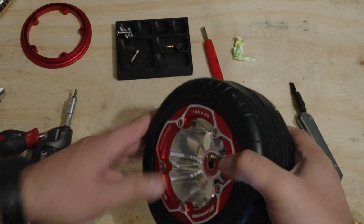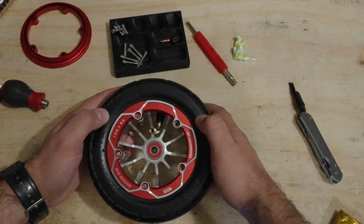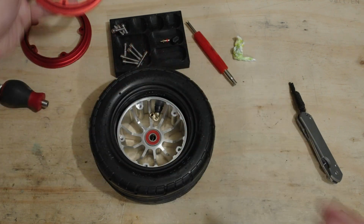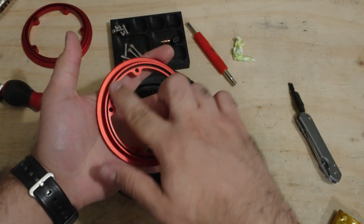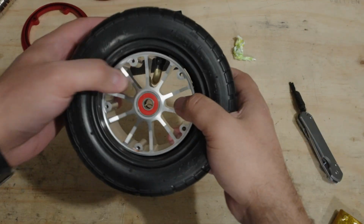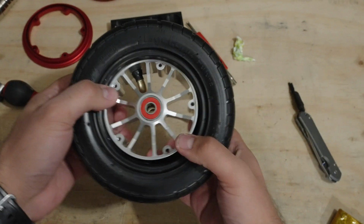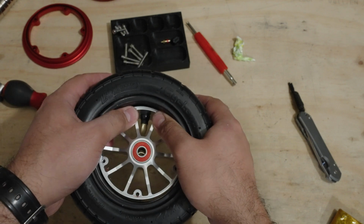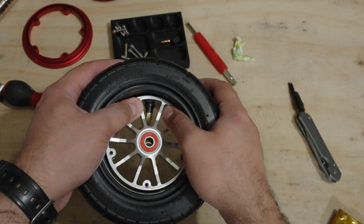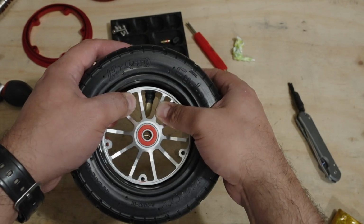And so it's just a matter of then removing, this is with a 3mm hex. I found that it's a little bit easier to sort of push it in to loosen it, and a little bit of that, and it should pop out. Now you notice that there's actually an O-ring seal in here that the lip of the inner part of the hub sits in, and that's how it seals. You gotta avoid getting it too angled, because if it angles like this, because it's catching the valve stem, you're not actually gonna be able to get it out. So you wanna put pressure where the valve stem is. I like to do it with my thumbs, and if you keep it pretty much flush and push it out forward, pushing more near the valve stem, the top of that grommet's going to sort of like bend over, and you can squish it past the bead.